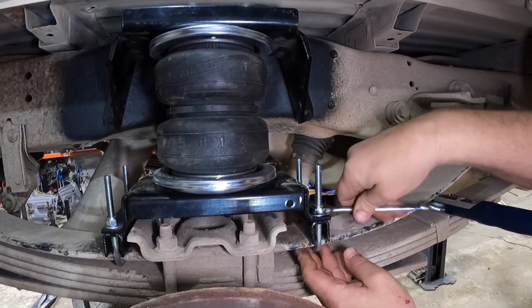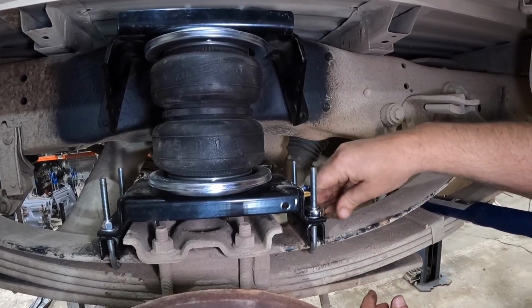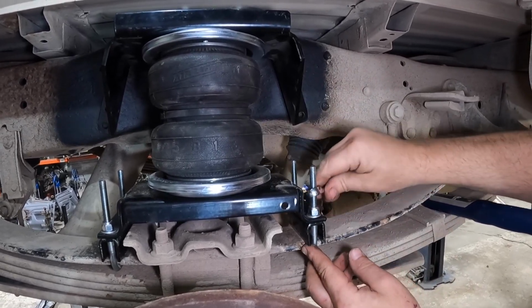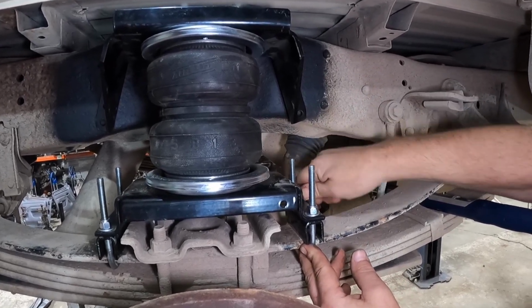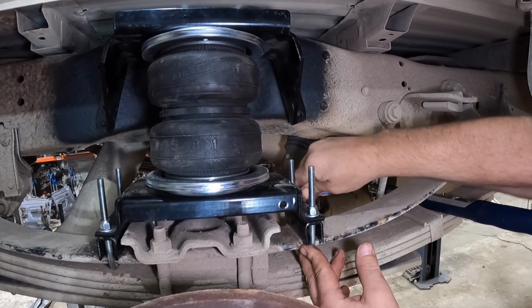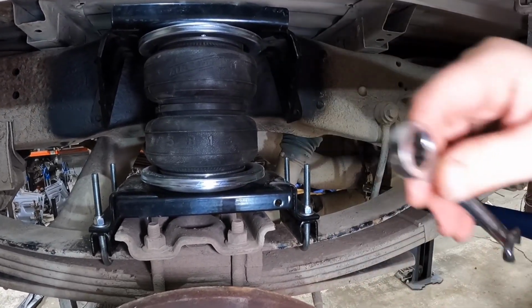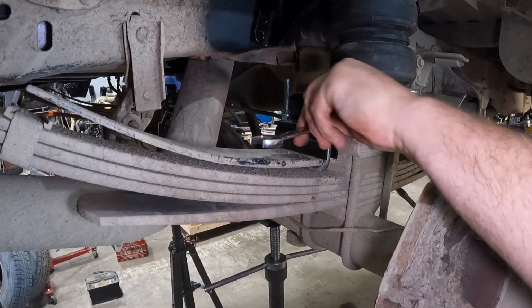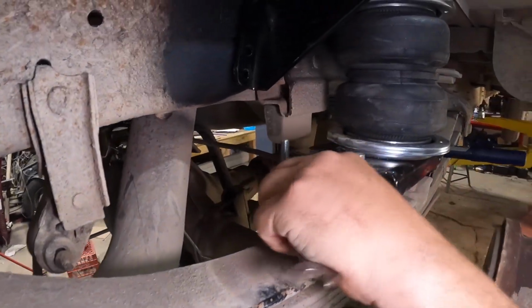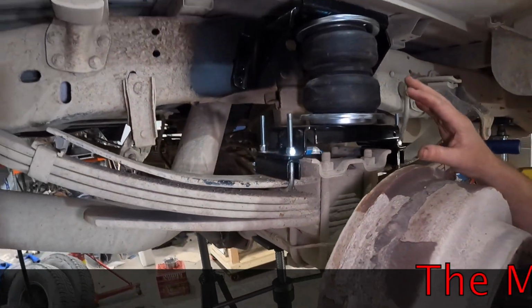That's pretty snug. And I'll grab close to the head of the wrench so I can't put that much torque on it. You don't wanna grab it out here. And we'll go around and do all 4 of them. And this will just kind of seat it in place. And again, if you don't want to do maximum torque, always grab near the head of the wrench. Let's do the other side. Ready? That one's very tight. We're gonna leave that alone right now.